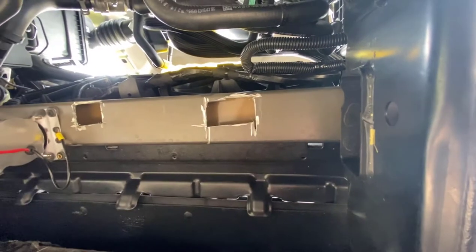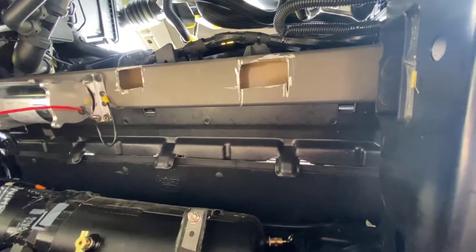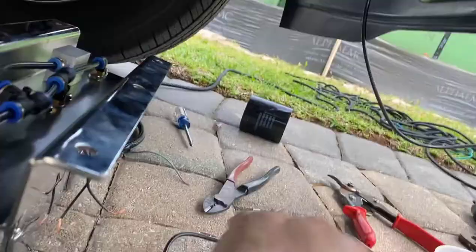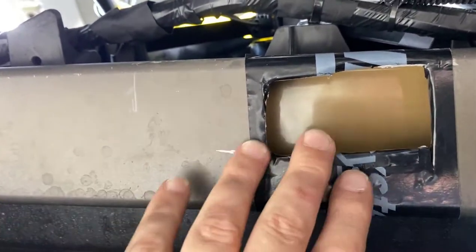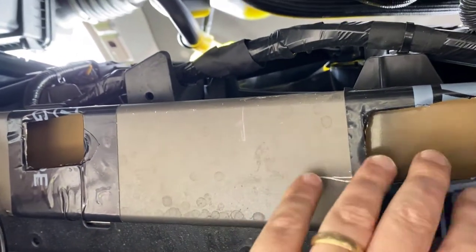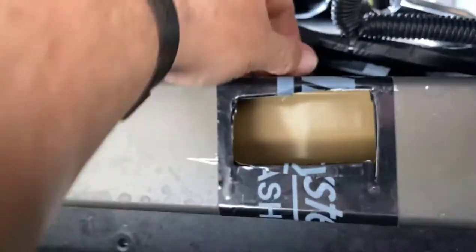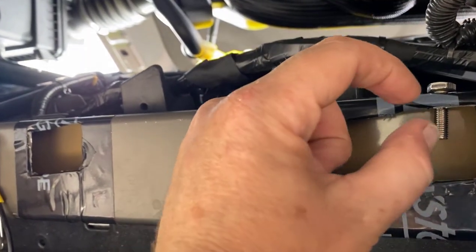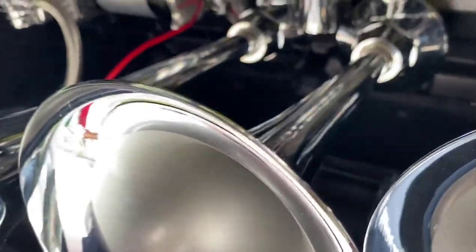Then I'll put flashing tape on there to waterproof and water-seal it, and run out my wiring. Before mounting with the supplied stainless steel nuts and bolts, I used flashing tape to cover the cut holes — even though the vehicle is aluminum and won't rust, I want it to look clean. I drilled holes from underneath to line up the unit, using lock nut washers sandwiching it in. That's where the air horns will permanently hang. Here's what it looks like with the three trumpets mounted up in there.